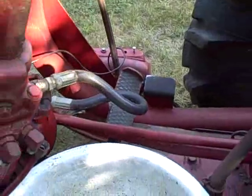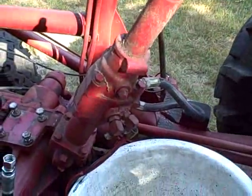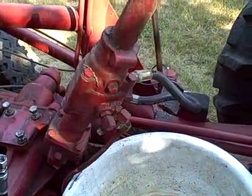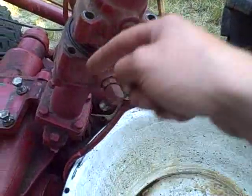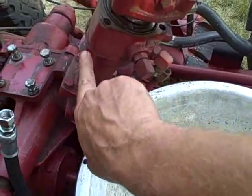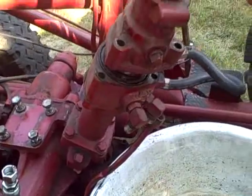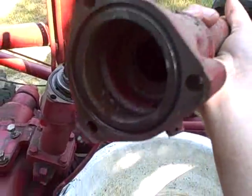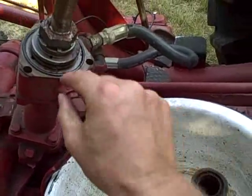I'm going to attempt to take these three bolts out and see if this bolster assembly will come off the top of the steering valve. That was a piece of cake. The long bolts go right through the steering valve and also bolt the steering valve down to the lower pedestal section — they came right out, and then this whole assembly comes right off.